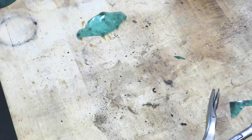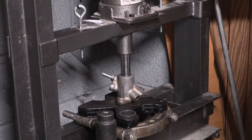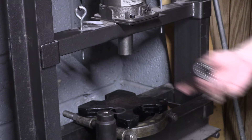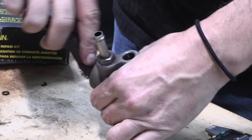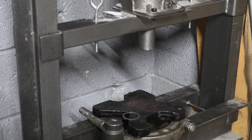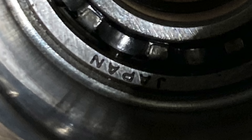Before I narrate too far ahead, I was originally trying to do something else to solve my problem. It was just easier to clean the housing in a blasting cabinet before continuing. There are two roller bearings inside the steering gear housing, one at the top and one at the bottom. In either case there's a seal on the other side because they're not lubricated by hydraulic oil — they're in a greased portion of the housing. You have to remove the bearing to replace the seal. They press out together easily with a hammer and a socket, or more gently using a hydraulic press. After that, you press the seal and bearing back in one at a time. There's your upper shaft bearing part number for Turbo DSM and Gallant VR4 racks.